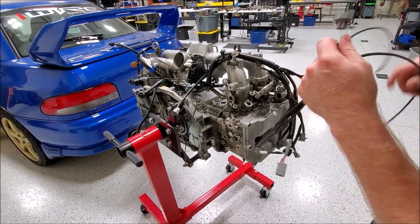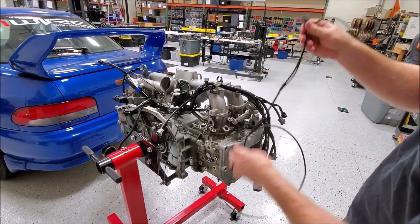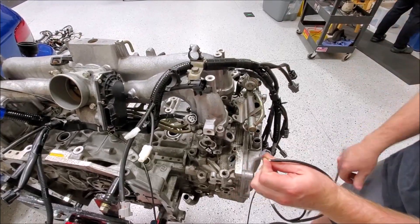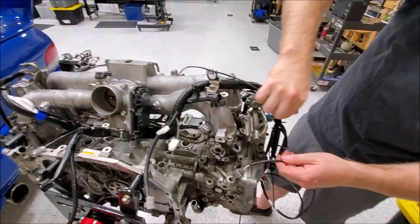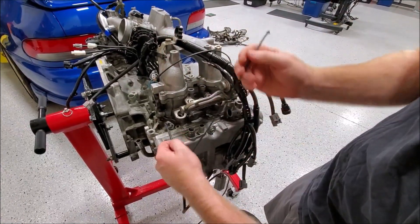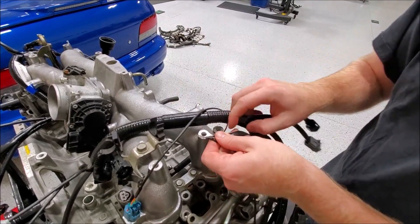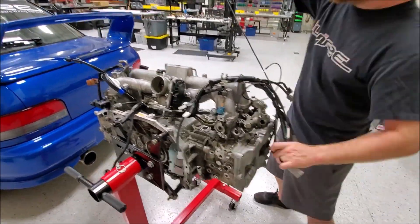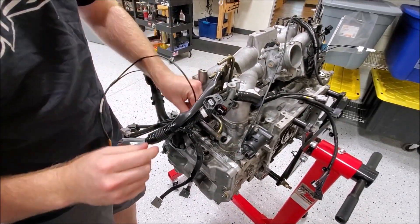Not quite the right application because these are US heads, but they'll do the job. The short side is on the passenger side of the car — the solenoid will be right here, sensor right here. The solenoid will come across from the other side — the long one — and plug in here. The ground ring terminal will attach like this, and the cam position sensor comes over to the driver's side to the back of the head, with the short solenoid right there.